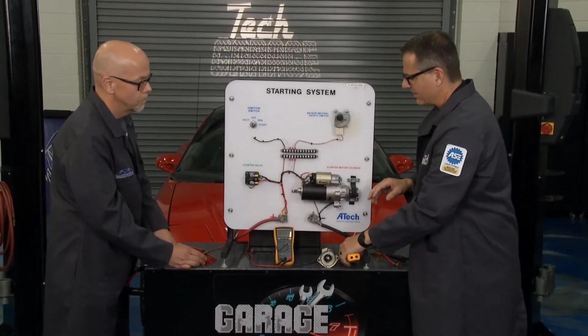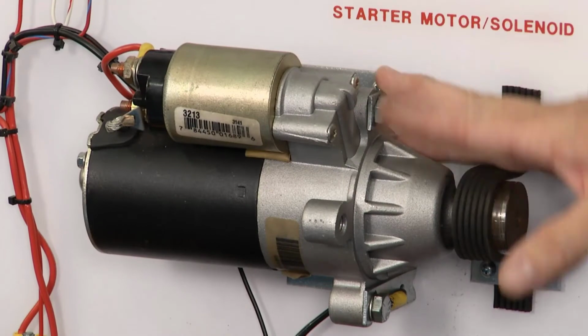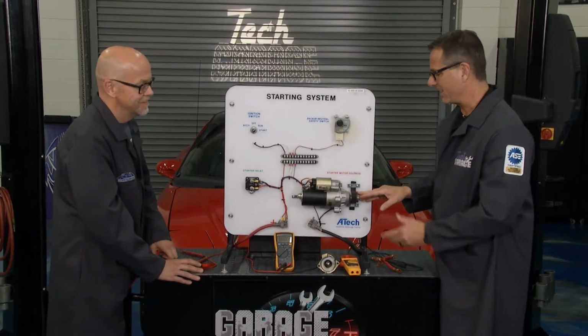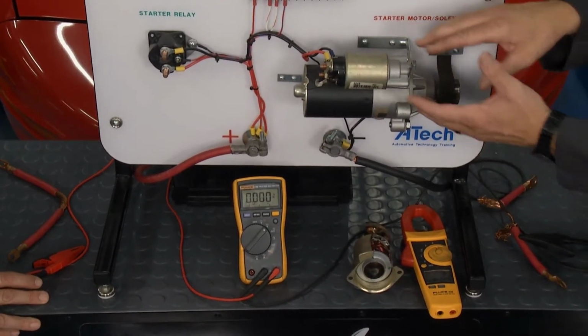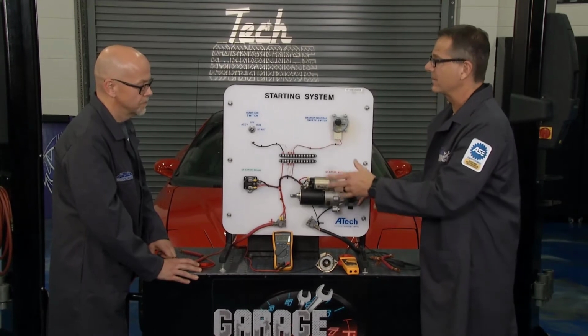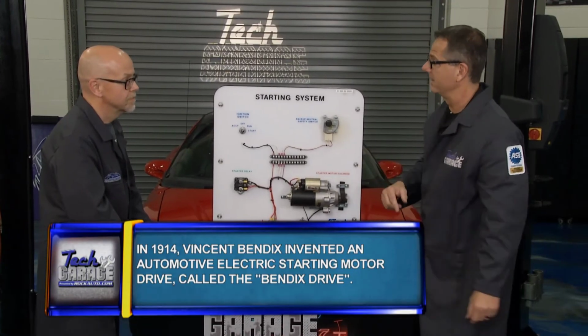What if I had a mechanical draw on the starter? That's gonna cause amps to go up. What would cause amps to go up on a starter? Having the engine attached there. Yeah, that's going to do it for sure. Having the engine attached, mechanical draw on the engine, thick oil, shimmed wrong, something that's causing this thing a hard time to spin, that causes amp draws there. Now, the other one is electrical resistance. Tom, I'll tell you what, why don't you get the RockAuto.com website set up, and I'll talk a little bit about shimming. Sounds good. All right.